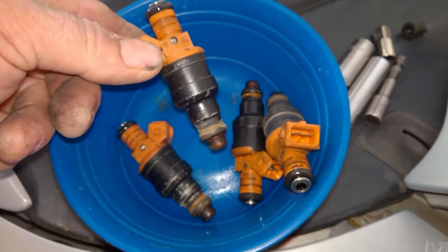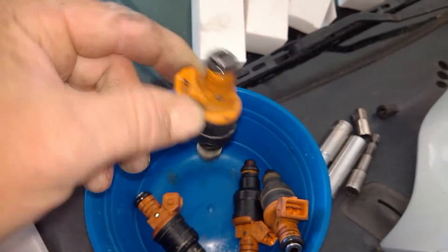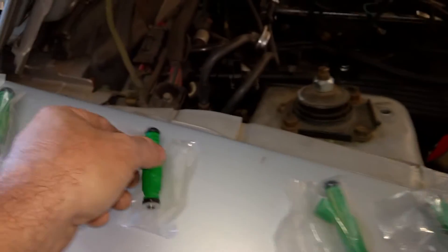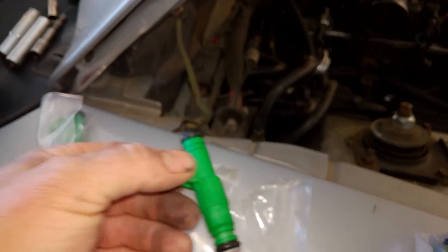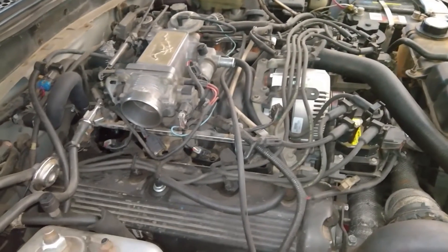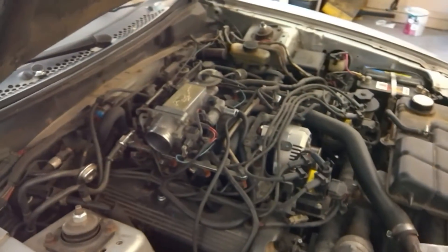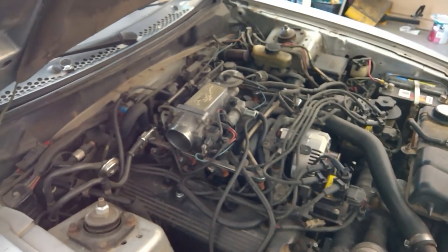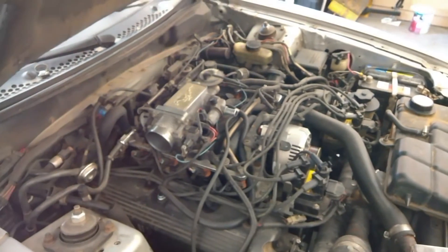Here's the ones that were in there — those Fat Body Orange 30-pounders. This is supposed to be a standard spray pattern because this is just a two-valve 4.6 liter. It's not the newer 4-valve one. I'm going to throw those in and then grab the Surface Pro tablet out, change the tune for the injectors, and see what happens.